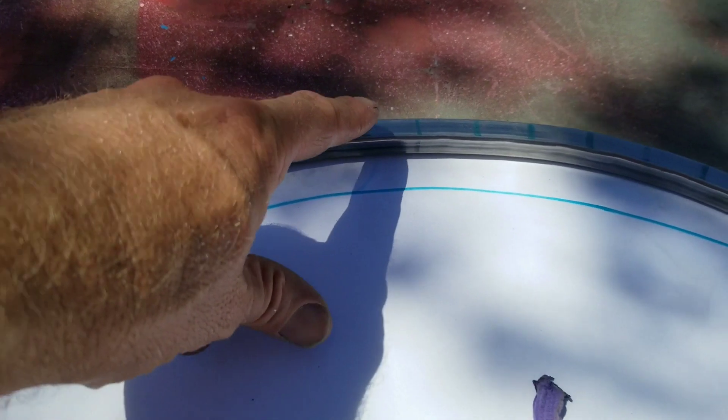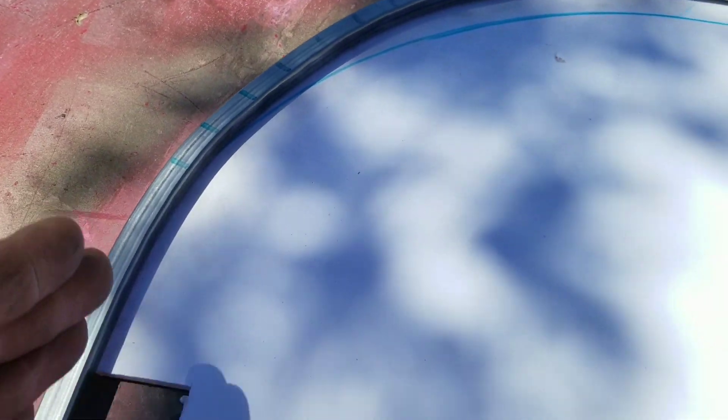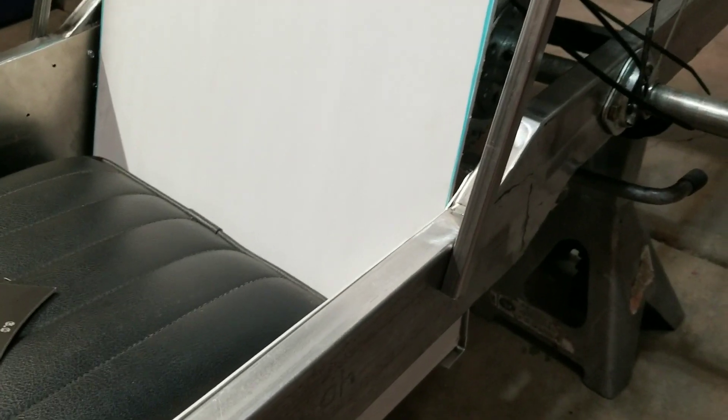This is going pretty good. I had to unbend and re-bend a few different spots — just go slow around. The idea is to start in the center, work your way around and get the contour, then work the contour down. I've got a little flat spot here. As you take the flat spot out, it brings this down, so you almost have to straighten it out, fix the flat spot, and then bring it back down. It's pretty close to matching up exactly with the piece of foam. I've got to keep the bottom 20 inches apart — that's how wide the frame is. This is a function of finesse and control. These things are never perfect in the first place, so if you get a hard spot or a flat spot, it's not the absolute end of the world — but it will carry through into your body work.